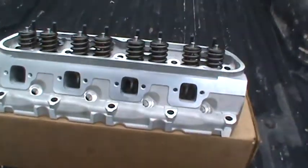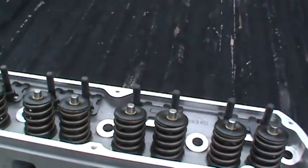What's going on dudes, Shawn here from Hammerhead Garage. It's been a while - I've been busy, I'm sure you guys have been too. Anyway, reason for the video today is I promised you guys flow numbers for these heads. I finally got them back from the machine shop, all done and shimmed up. I was able to get over yesterday and get them flowed - a buddy of mine owns the flow bench, it's a SuperFlow, and all the tests were done at 28 inches of water, which is the industry standard.